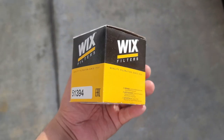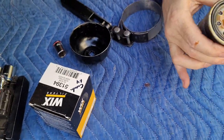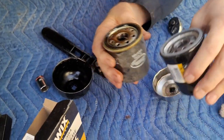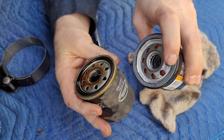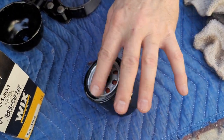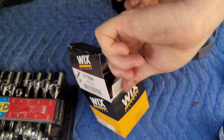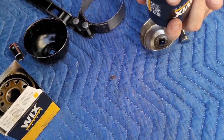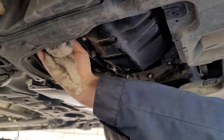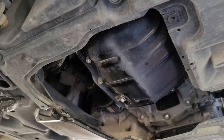We're going to change out the filter once all the oil from the oil filter has been drained. You got to make sure that they both match — thread size and where the seal goes. Looks pretty good. You want to lube the new oil seal up with a little bit of oil for lubricant. Put the old filter back in the box. We're using Wix filters by the way — not sponsored, but it's a good brand. I'm going to clean the surface of the block before I put the new filter. You don't want any dirt underneath the filter seal — that's going to leak. It also ensures that the old seal is not stuck on the block.